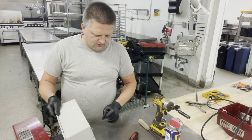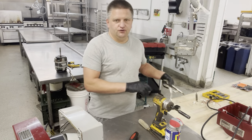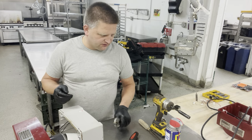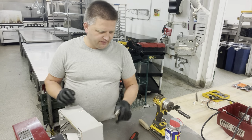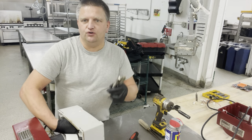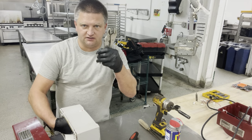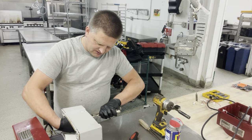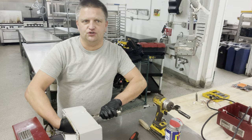One thing I forgot, use a pliers of any sort, anything where you work. As I say, it could be a socket wrench or it could be regular pliers. I prefer pliers because I have a good grip on them. One hand you hold onto the switch from the inside of the base, the other hand you turn the nut that's securing your safety switch,